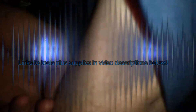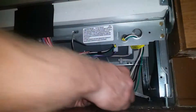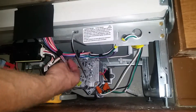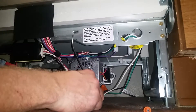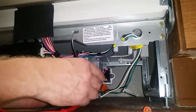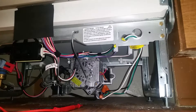So I started through the normal troubleshooting — verified I have power, I had power, and then I checked the neutral. I had a neutral, had continuity. Unplugged everything, did continuity testing, and looked through to figure out what was wrong with this dishwasher. I was getting power below, had voltage detected with the non-contact voltage detector everywhere below, so it was time to look further.